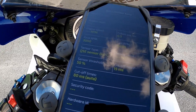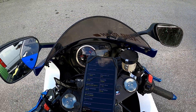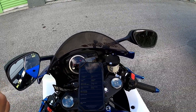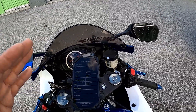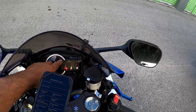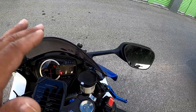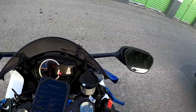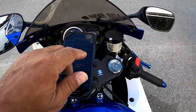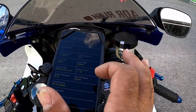What 'first RPMs' means is at what RPM do you want to program it to start shifting. You can set it up for 2,000 RPMs, you can set it for 3 - I left it at 3. The 'last RPM' means that's where your bike's upper limit is. If you have a 17,000 RPM motorcycle, you don't want to exceed that because once you hit 15 and a half you're already in the red zone. But I got this bike dialed in to go around 16,000, and for this app 16,000 is not enough - I have to go either 16,500 or 17,000.